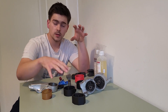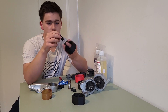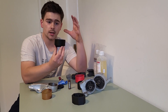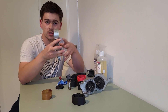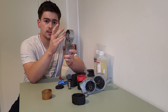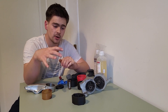So right here I have the moulds in which we're going to pour the polyurethane and make our DIY bushings. For example, this one right here has a surround, a base, and a small plastic tube which will sit in there, and then this goes around it just like that. We're going to pour the polyurethane and once that's hardened, we're going to have half a bushing. I have two identical moulds, and once we have our two halves, that's going to add up to one bushing. What we're going to do then is push one half in from this side, one half in from the other side, and we're going to have a bushing inside the engine mount, plus a small extension which will fill in the gap between where the metal part ends and where it is mounted in the engine bay, creating a very solid connection with very little to no play.